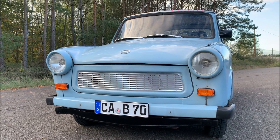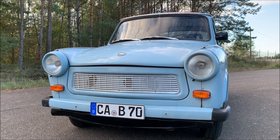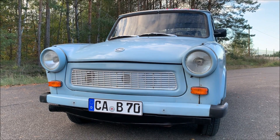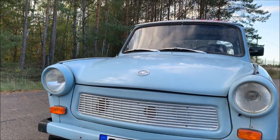This black metal piece underneath is avoiding too much air from flowing underneath the car. It's basically a cover for the exhaust system which sits in front, but aerodynamically it also helps to reduce lift at the front because less air can go underneath the car. We have a pretty big air intake, but on a closer look there are three holes.